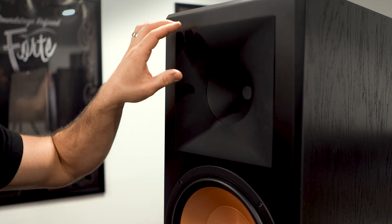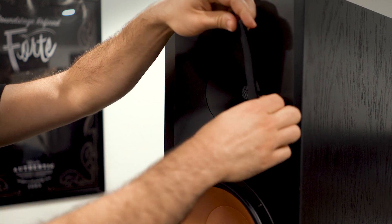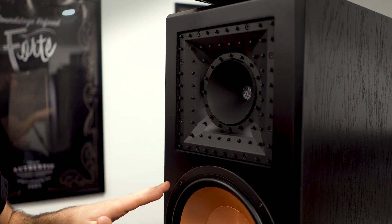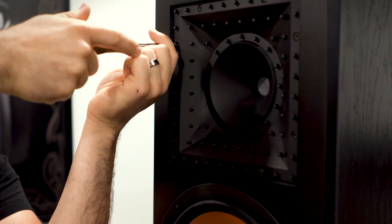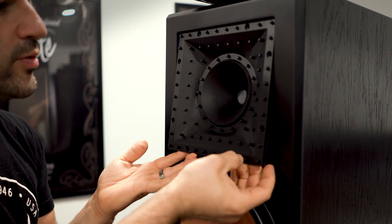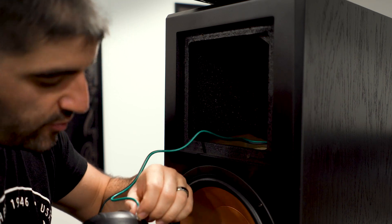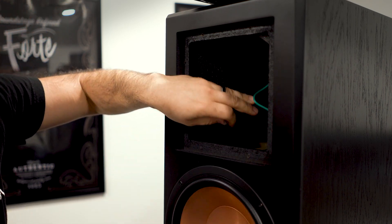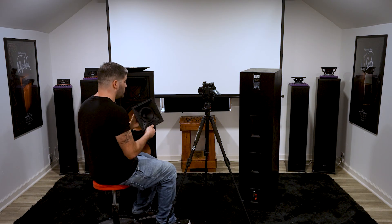Similar to the RP8000Fs and the RP6000Fs, you do not see any screws when you're looking at the compression driver. All you have to do is pull off this piece here and it'll reveal the screws underneath. Now it does use a T20 star bit. Now that you have all the screws out, you do only want to pull it out a little bit, because you're going to want to remove the wires. You take your fingers, pinch in here and you can pull that out — and that is how you remove the compression driver on the RF7s.